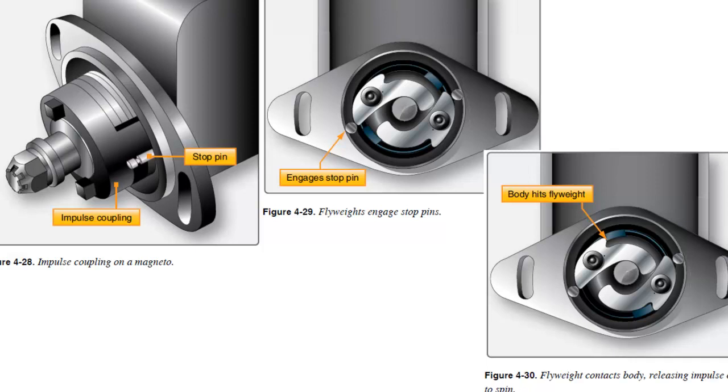The simplest way to do that is the impulse coupler, which all our 152s have and many of the 172s have. It's a wind-up device mounted between the engine and the magneto. At very low RPM, a set of centrifugal dogs engage a stop pin and it stops the magneto from turning while the engine continues to turn. When it gets wound up to the point where the cylinder is at top dead center, it contacts the body of the impulse coupler and releases the spring, and the magneto catches up really fast. So it accomplishes both things we need: it delayed the spark to top dead center, and because the magneto turns really fast as the spring catches it up, we get a hotter spark. Really simple — it doesn't require battery power. Really cool little system.